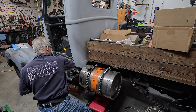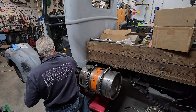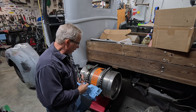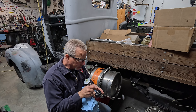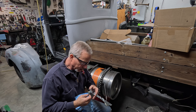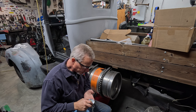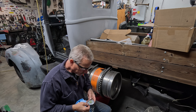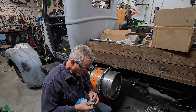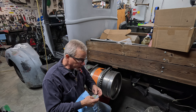One of the other little things I've got to take care of is my gas sender units. The sender units are universal and I followed directions, measured the tank depth and adjusted the arm length. But right now it's showing there's still fuel in it when it's empty, and when it's full it's showing it's not quite full. So that tells me the arm is a little too long — it's hitting the bottom of the tank before it gets all the way down, and sitting at the top before it comes all the way up. So I'm going to pull it out and shorten it. It's a real easy thing to do, and you can do it to your gas sender unit if it's reading incorrectly for your gauge.